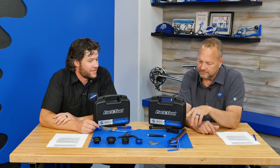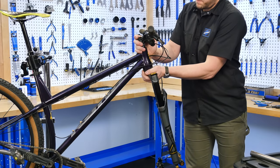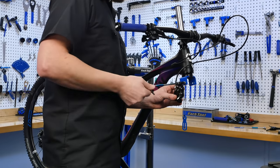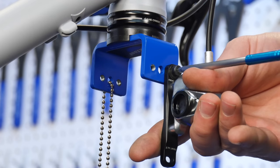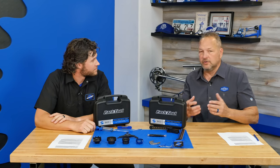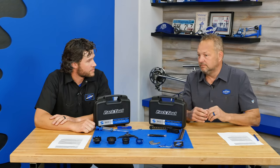This is the latest in the dummy series — we have a dummy pedal, a dummy hub, and this is a dummy fork. The dummy fork is primarily for shops doing suspension service. It takes the place of where you took your fork out, keeping all your headset bearings, headset spacers, stem, brake hoses, and shifting cables intact and in the exact place they came from. It also gives you a place to mount your brake with a pad spacer for disc brakes.